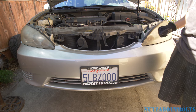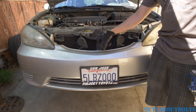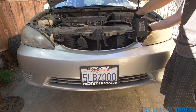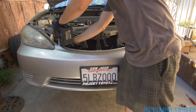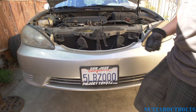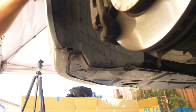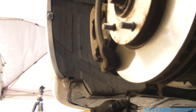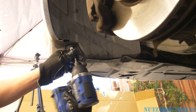First quick thing we can do: there was a clip in the middle but it's missing, so you've probably got to pry a plastic clip out of that location. Then there are also a couple of screws you can take out with a 10 millimeter socket — that's the easy part. Then we'll go to the sides and take the clips out for the fender liner. We're going to have to peel back the fender liner to get a screw that's holding the bumper to the fender, and then down at the bottom take a couple of screws out that hold it to the engine undercover.